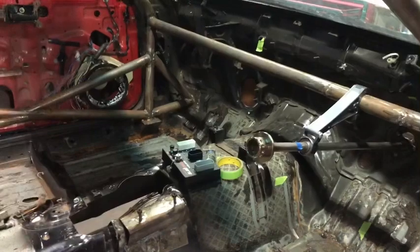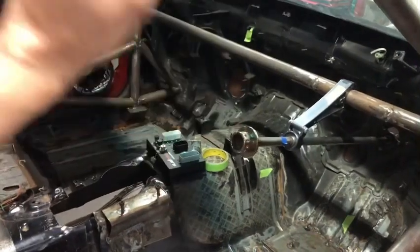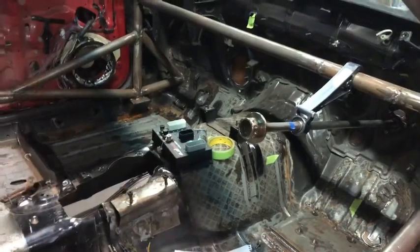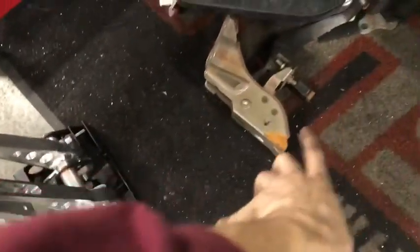We got most of the wiring done. I decided that for now, since I don't have the budget, we're still gonna stick with the MS3 Pro. We're gonna run the MS3 Pro and a whole bunch of switches and relays. More than likely this first relay box, I'm gonna do the most simple I can and just have it run the car. Eventually I'll do V2 of the relay box, where I'll put the rest of the stuff, like my nitrous and whatever other silly stuff I wanna do. Or in hopes I don't even have to do that, in hopes that I can just go PDM. The next step was figuring out the pedal box and how to do a brake switch.